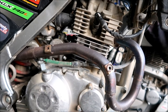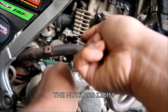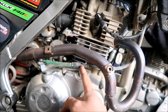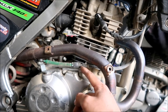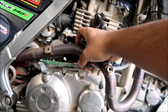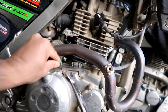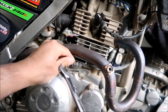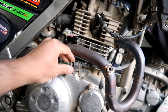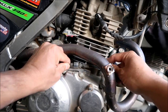Now it's a lot easier to work on. Take your open-end wrench and loosen these nuts. Remember to take note of how many threads were exposed from the base to the nut - it was about four threads. One, two, three, four. It's not super critical, but when you put it back just get it adjusted the way you like it. Pull that boot out.